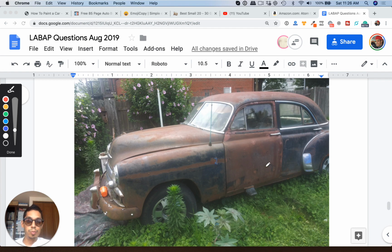And then later on, you would put a 2K filler primer on top of that, but the epoxy primer will buy you time until you start finishing the rest of the car. Okay? Then the next day, maybe next week, you'd want to tackle the hood. Sand the whole hood down, get it ready for primer, and just prime it down.